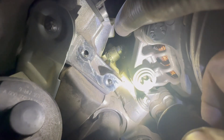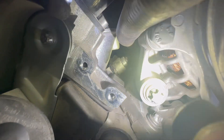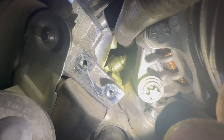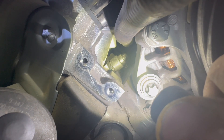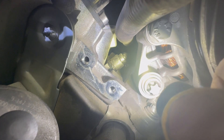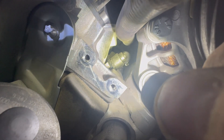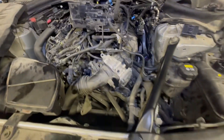Back down here, as you can see, the hose has already been replaced and attached to the cylinder head fitting. There's just one of those little C-clips and you pop that out. A nice little trick I like to do is use a little bit of Dawn dish soap on the new O-ring — it just helps it slide onto the fitting a little bit easier. You just gently push with a screwdriver on the back of this plastic fitting and it'll just pop into place. Installation is obviously reverse order. Thanks for watching.